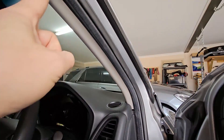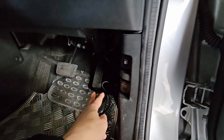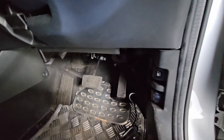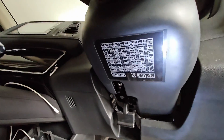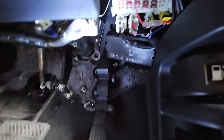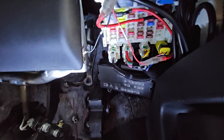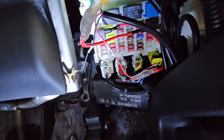I've got the cable running down for the power all the way down there, and there it is with the hard wiring kit. The fuse box is right under there and under the steering wheel is the fuse diagram. I've used fuse 37 for the yellow cable which is accessories, and fuse 1 which is door lock for permanent power.